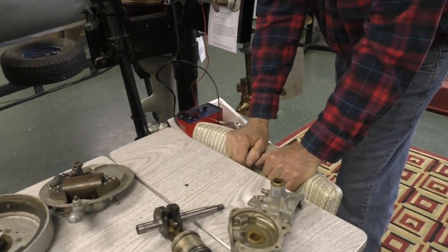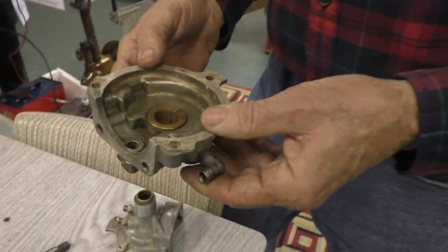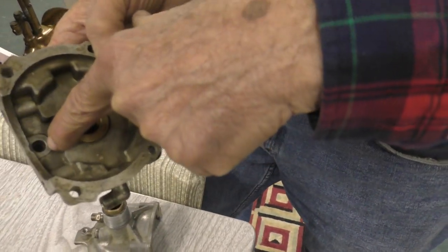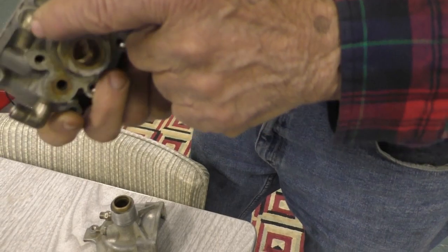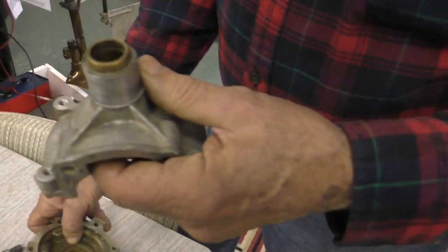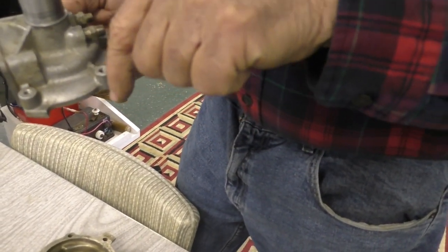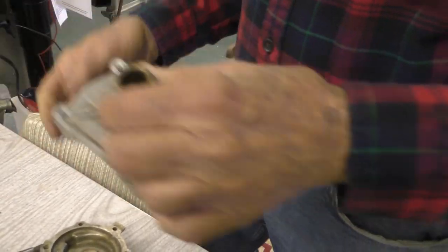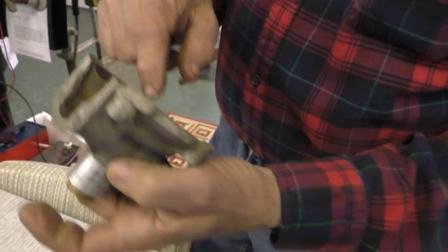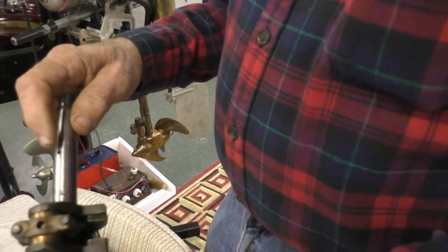This is a little deviant from miniaturization, but while this is apart, I also wanted to talk about the lubrication system, which was unheard of. This is the bottom of the crankcase. There's a catch basin, and a passage with a screen in it, which goes to a fitting with a tube that goes over to this place on the crankcase, and this tube goes over to the intake by the carburetor. So it pulls a vacuum on this whole system, which sucks the oil out of this area, up into the main bearing, and through passages inside, access holes that line up with a hole in the crankshaft.